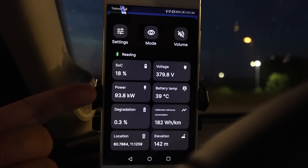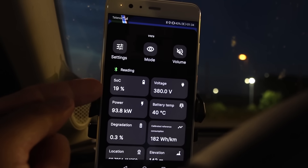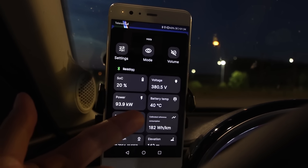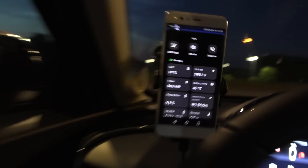I asked the livestream chat — they say it throttled at 16%. That's 5% earlier than ideal. So already at the first charging session we stressed the battery enough. The rapid gate point seems to be at around 39–40 degrees Celsius. Throttled at 60kW. Looking at live data from the better route planner — we started at 100kW but then dropped. Now we're at 84kW. We're supposed to get that speed until 58%. I think I need to stay until maybe 60% then.